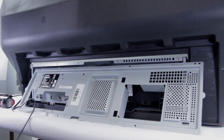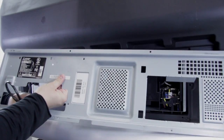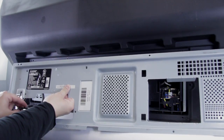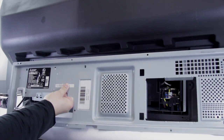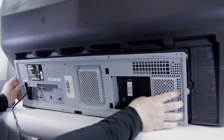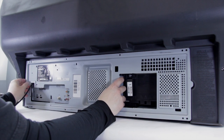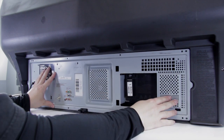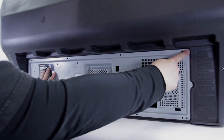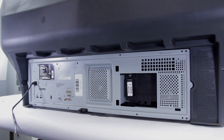Now for the back panel — the first thing we need to do is take our power cord and just pass it through the hole. Just be careful of the edges as sometimes they can be a little bit sharp and can catch the power cable. You want to make sure that this metal piece right here sits on the other side of this plastic — if you don't, the back will not go on. Once you've got it on that side, go ahead and push it in place, and you'll see that there are little plastic pegs that should line up in each corner. Once that's done, you can go ahead and start putting screws in.